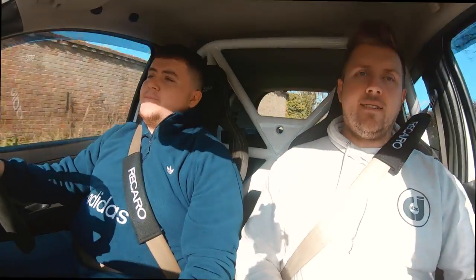That's a sucky problem — you wouldn't look for it. The fuse box was bone dry to look at. Where the water gets in, it's got like a foam seal on it that fills up with water and completely expands, and that was just soaking wet in there. What have you done to protect against it now? Just a new arch liner. I didn't realise all the clips were missing — it had sagged forward and there was probably about a half-inch split where you could see the water was getting in.